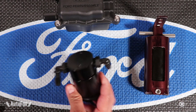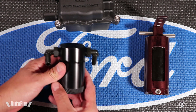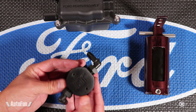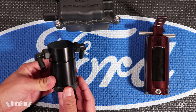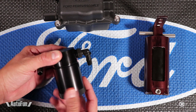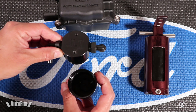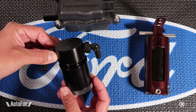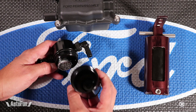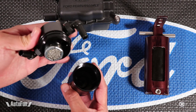Now let's look at the JLT. This version has been sold for many years and has since been superseded by the newer JLT 3.0. There's no inspection window and no drain hole. But that's not a problem — it's actually really cool. Since this is installed in the car vertically, all you do is unscrew the bottom, and now you have your oil that you can go dump. It doesn't get easier than that. You don't need a separate container to catch the oil — this bottom piece is what you take away, dump, and reinstall. A really, really cool system.